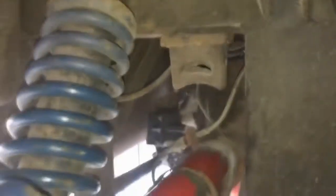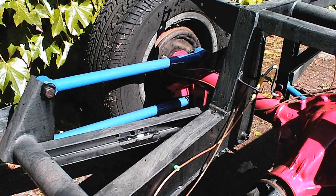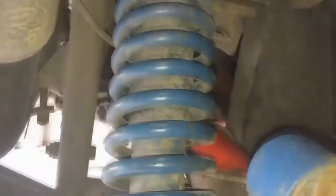Nothing's held onto the bodywork obviously, and then the two swing arms either side go off to chassis members again. So it's held in one, two, three, four points either side — one, two for the Watts linkage and one, two fitments at the top here. And that is your Salisbury axle — a very nice axle.